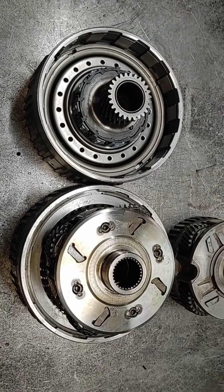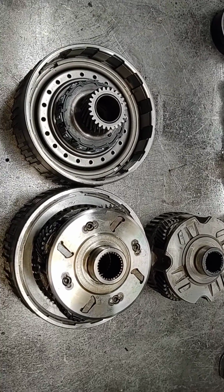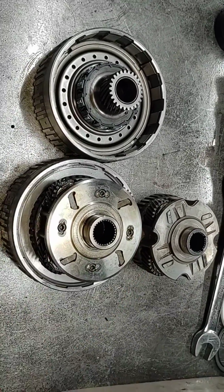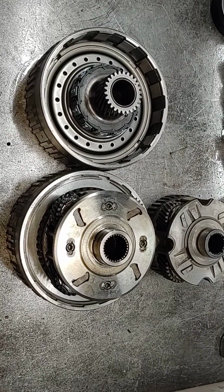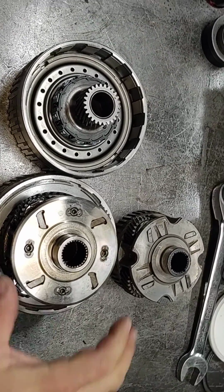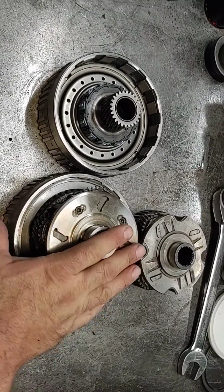So I've always said that realistically 1,700-1,800 horsepower is about the limit of a 480. And this is the reason. Even with a billet overdrive, even using the early style, some lube modifications we do, 1,700-1,800 is a comfortable number for us. Above that, I think we're going to see some issues over time. But at that point, just about every transmission is a maintenance item, so that's something we can live with. So just an idea: ultimately, this is a weak point.